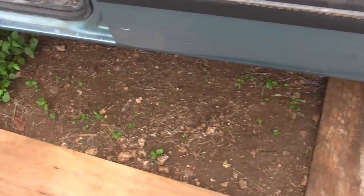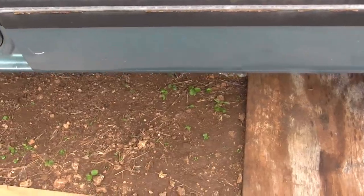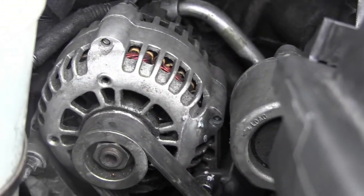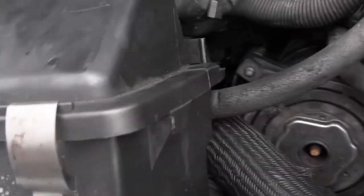Got the leak on the transmission sorted. It was a 13mm line wrench, and I hadn't tightened it enough, or it was loose I should say. Finished the transmission mount and did the exhaust manifolds, got those on, got the belt on, put together the upper radiator shroud and the air filter, and I've got some problems with the fit on this oil fill tube, but I'll get that sorted after it quits raining.